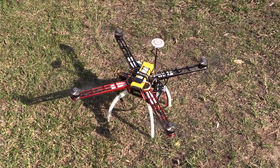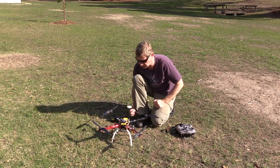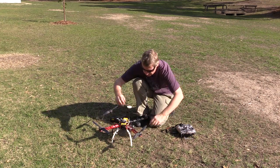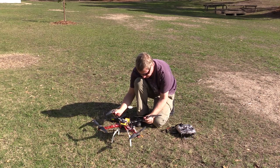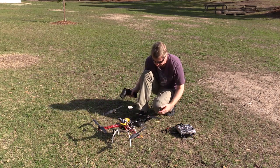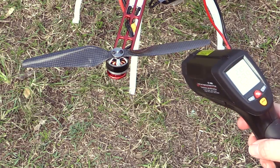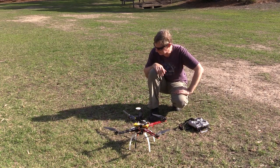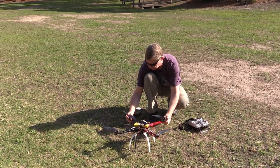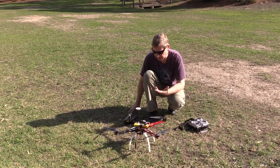It's going to be interesting to see how long that lasted. So let's shut it down. Just to recap, that's running the yellow Zippy battery — same capacity as the Turnigy I ran last time, 3.3 Ah. The motors — just disconnect the battery first — they're only barely lukewarm, but I think that's more of a function of being out in the sun today. I don't think that was a valid temperature test — reading cooler than before we took off, but the sun was in and out of clouds all day. The motors certainly don't feel warm to touch at all. I think it might be better to try this on an overcast day where it's more consistent. Anyway, there you go.